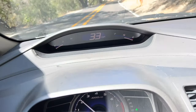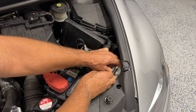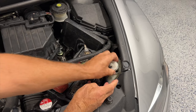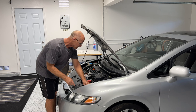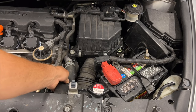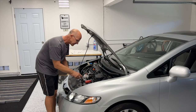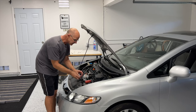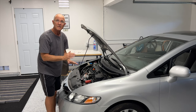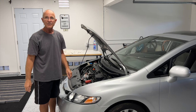This is the next morning — my car is completely cold, and this is a good time to check everything. First, let's go ahead and check our coolant reservoir bottle. That's looking good — all fresh coolant in there, and it's right at the full line. Next, let's remove our radiator cap. There's no pressure on this system because it's completely cold — I can even push the hose right here. Let me dip my finger in there — it's right at the full level. This was a total success. I've got great peace of mind knowing my system is awesome. If you like this video, give it a thumbs up, subscribe, and I'll see you in the next video. Thanks for watching.